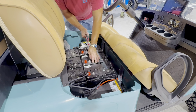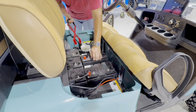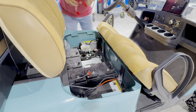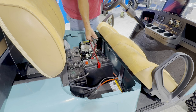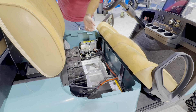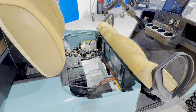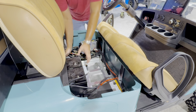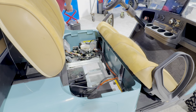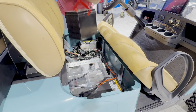I forgot to mention — in my last video I was very adamant about safety and protection gear. The reason I haven't mentioned it on this video is that I'm using sealed AGM batteries — these are Continental AGMs, brand new. I think they're takeout batteries from an Icon or Epic golf cart we had in stock that was upgraded to lithium. These are the best possible alternative to a lithium battery. They've got a bad reputation online, but in my opinion that's because when Icon put these in their carts, they never programmed their chargers correctly from day one and had a lot of issues with them failing. When we install these, we also install the correct charger, so we've never had problems. I can count on one hand how many times we've replaced these under warranty.